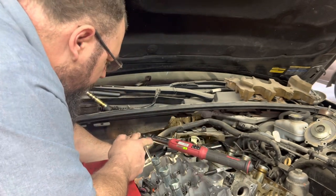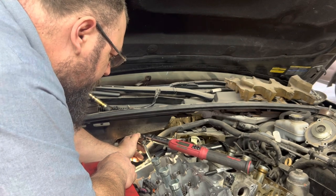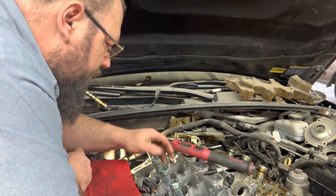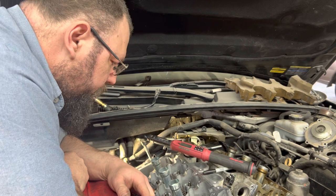This is where these things come in really handy, because back in this corner — you saw me on the time-lapse having to readjust the breaker bar because I don't have the big long ratchet with me right now. You're not supposed to have to do that. You've got the hood strut in the way. It's almost like when they build these engines, they build them outside the car. I hope this helps you guys out with how to do torque-to-yield. It's not really that complicated — it's tedious, and if you get disturbed in the middle of it without taking precautions, you will lose your place and make big mistakes.